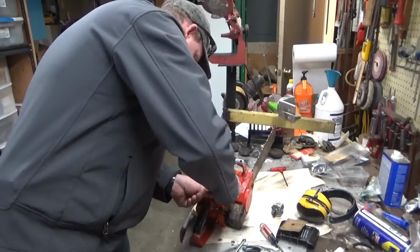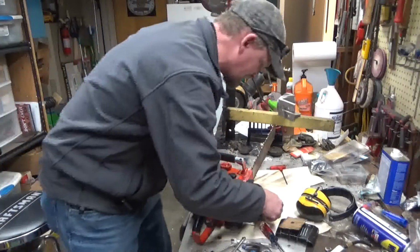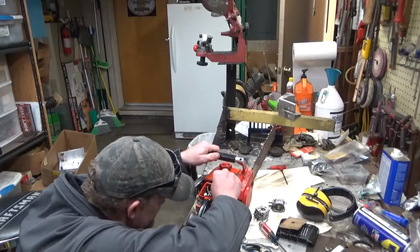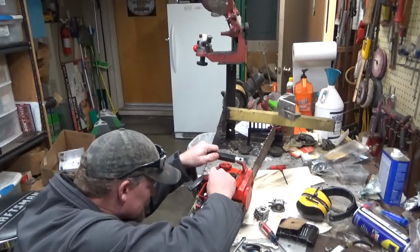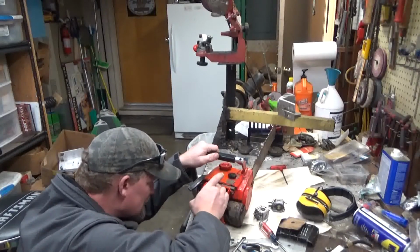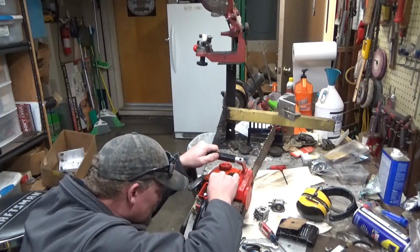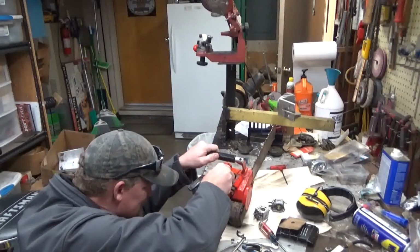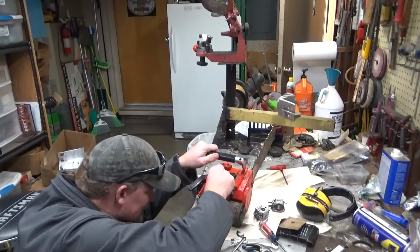Okay, I see that my gasket stayed put here. That's a bit of a problem. I mean, it's good normally, but Martin's is still on the carburetor, so I can't double gasket this. I'll probably destroy this one taking it off, but we'll see. Maybe I'll get lucky. I'm using just a regular razor blade carefully. One of these regular, not the tool one, just the straight razor can be really invaluable for getting stuff loose, or just cleaning up old gasket material. Yeah, that tore all to hell. Damn it. That was not the outcome I was hoping for there. But like I say, I needed to do this anyway, and this was good motivation.